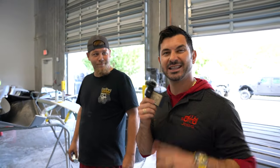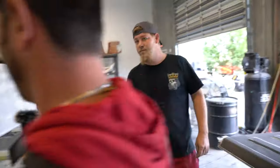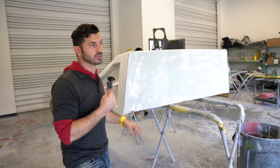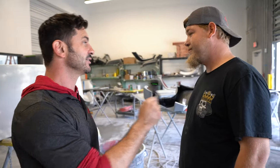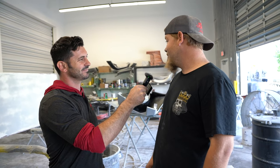Second booth getting up and running — this is our high-gloss paint shop, but we have some unsung heroes right here. What are we doing today? That's the slant back — we're sanding it down, getting all the little pinholes out so we can put some gloss on it. You spend countless hours here making sure it's 100% perfect before it goes into high-gloss. It takes quite a long time — it's like a three-step process before it gets to gloss. Fiberglass is really unforgiving. If you don't sand it down properly and that first sanding isn't right, it'll all peel back. The good thing about fiberglass is it never rusts and it's very lightweight so our cars are a lot quicker.